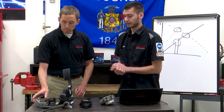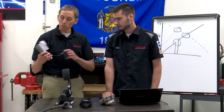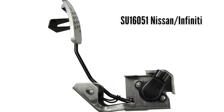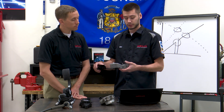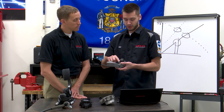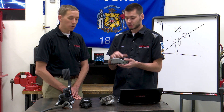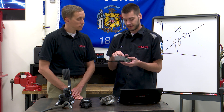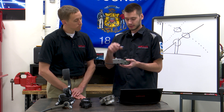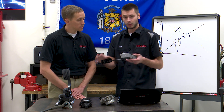Let's talk about what pedals we have here in front of us today. We have a foreign and domestic — we have a Nissan. This pedal right here is a Nissan 350Z, roughly 2003 to 2008. This one's unique in two things: one, the sensor mounted to this comes as an assembly and has oblong holes. If you were to loosen these two screws here you could adjust this sensor on here — but I don't recommend it. It's adjusted at the factory. You'd have to be messing with voltage levels. Don't do it. There's a paint mark across the screw to the housing — make sure it stays there. These things are pre-set up, and that's why we get it as an assembly.